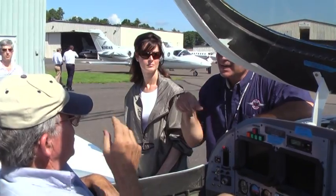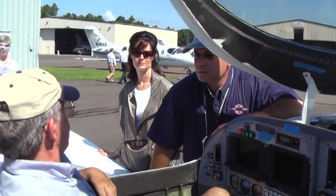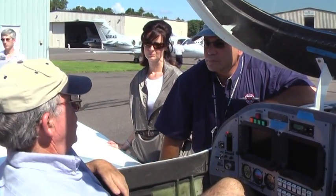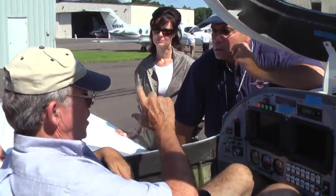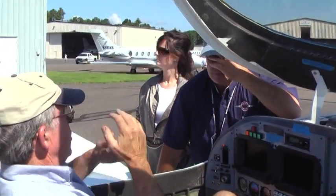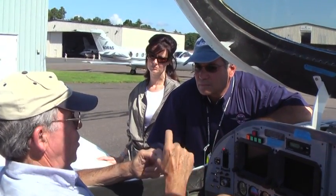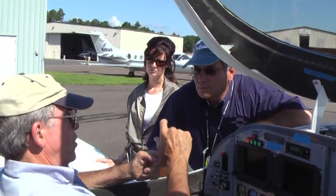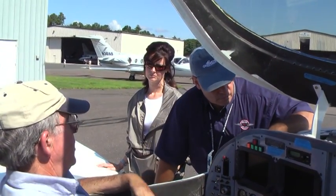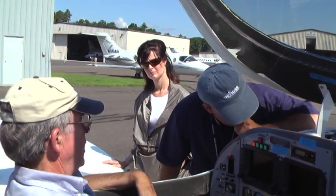The whole thing before is you've got to leave the pump on low to start it. That's what I always do. We went through the checklist and modified it a couple of times, and I got confused about what it is. We need a separate segment about what each piece is for — you blend it all together and start reading it. I'm just starting the engine. So I ought to have just a block for starting the engine: high boost to prime it, low boost to start it, mixture rich — all of that kind of stuff.